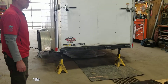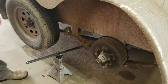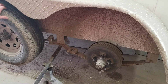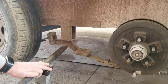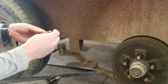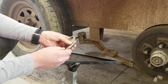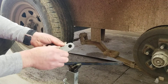I thought I had caught it soon enough — I'll show you the play we have in this thing. This is the same setup I have up on the table there. You can see the equalizer here, a little bit different design but does the same thing. We want to check this out — this is a simple way that we check these. You can see there is just a small amount of play in there as I'm pressing up and down. It doesn't seem like much, but it's enough to cause issues. This is some of the parts we've taken out of the other side of this trailer. You can see the wear in the top of this shackle here, along with the bolts as well. We've caught it early enough where now we can just change out the bushings, put brand new bushings in it, put brand new axle straps in there, and then get this person on their way again.